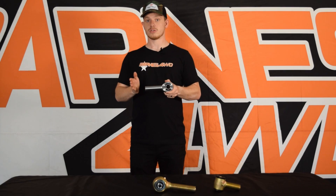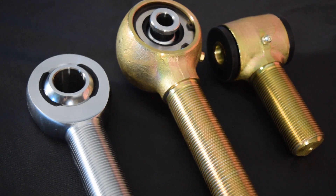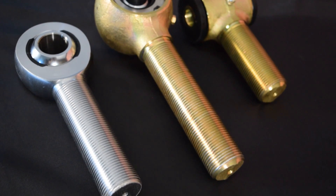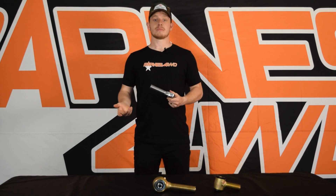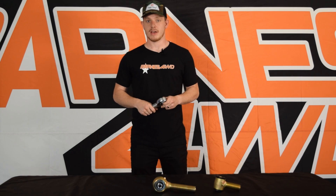There's also an oil-impregnated Teflon liner that keeps the ball lubricated and free to move when your suspension is articulating, going full droop, full bump, and all that. This is a Magnum Series heim from us, which means it's a long-shank design — just like the Enduro Joint — great for people running aluminum links who want that adjustability and thread engagement. A heim joint sounds great because of how strong it is, however that strength comes at a price — and not just the purchase price, but the cost of maintenance and on-road comfort.